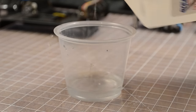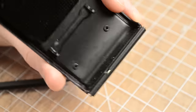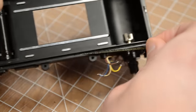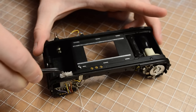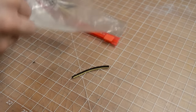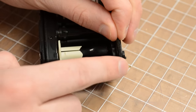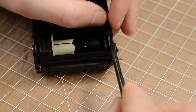Now that we're all fueled up, we can pour out some isopropyl alcohol and start working on those disintegrated light seals. As you can see, they didn't use the worst quality light seal foam known to man, and even 40 years later, these things hold up pretty well and usually come out in one large piece. I'm giving the light seal channels one more wipe down to get rid of any loose dirt and debris before busting out some fresh light seal foam. I'm just manually cutting the light seal foam to size and replacing all the foam around the interior of the camera as needed.